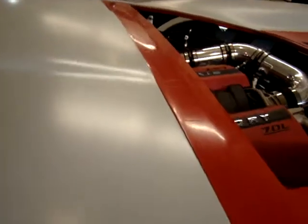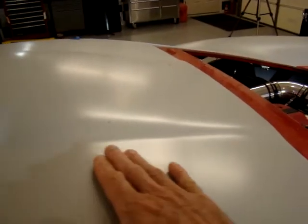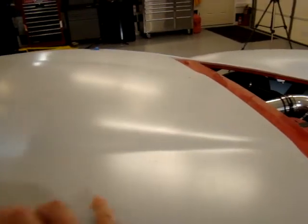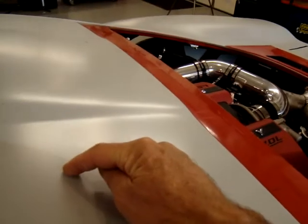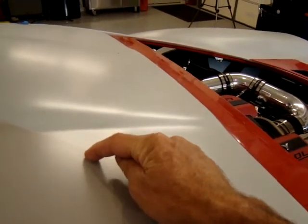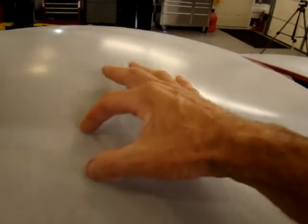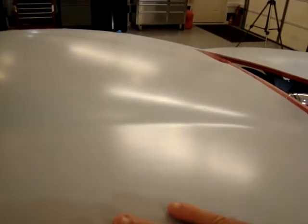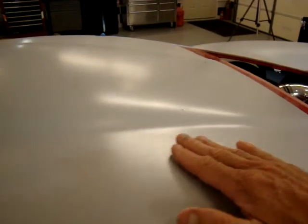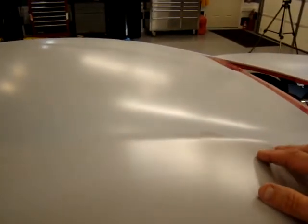Anyway, so again, this is real challenging here. You have to basically grind that flange down. When you get this piece, you'll cut some off of the sides. It'll extend all the way out pretty far. And what you want to do is cut that flange in on that whole scoop, and then sand down the edges of that flange, so that you can get that thing as thin as possible as it begins to transition into the roof. And then you glass that in with matte mold glass, and you'll end up with imperfections, and then you'll come back and fill that in.